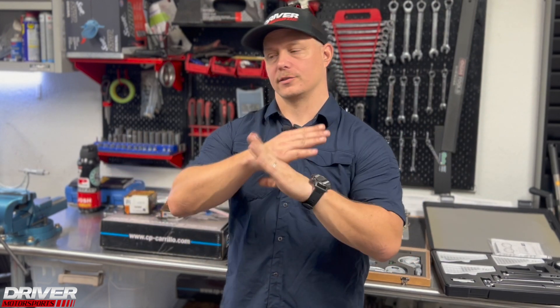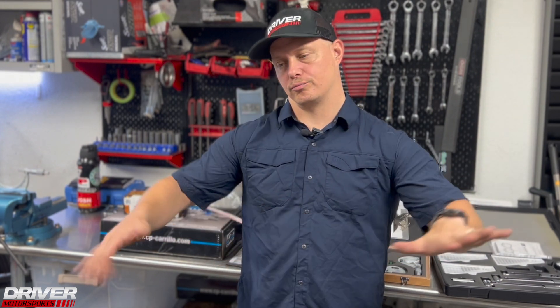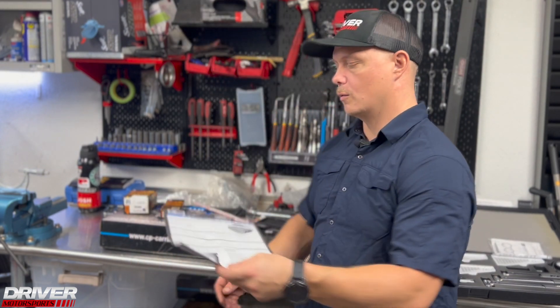The last thing I want to cover is how to figure out clearances when installing aftermarket components — such as cams, a stroker kit, or other variables added to what was originally an OEM engine. The technical manual is written for a bare-bones stock OEM RB26 application. If you change cams, tolerances, or anything due to an aftermarket component, those OEM measurements go out the window. So how do you follow the technical manual when it's now incorrect? The answer is that aftermarket products come with specification sheets.